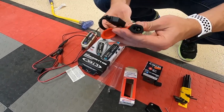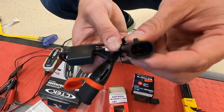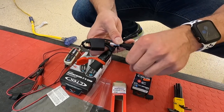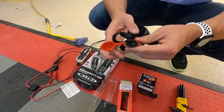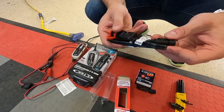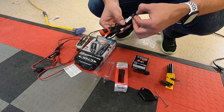It shows it's weather rated and comes with a three-year warranty — pretty simplistic, no witchcraft here. This here is the SAE end with a weather protection guard on it, because this end hooks onto the bike. The bike has a little yellow guard to help secure it and make it weather-tight, so this one will plug in and stay connected. This one is obviously exposed when not charging, hence the weather protection. It's fused — this one came with a 15 amp fuse. It is not a heavy gauge wire, so don't try to jump the bike through this; don't run a jump box or a car through it — you'll melt something.